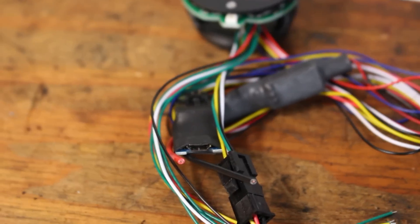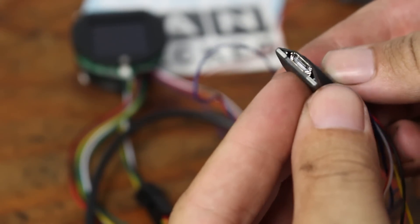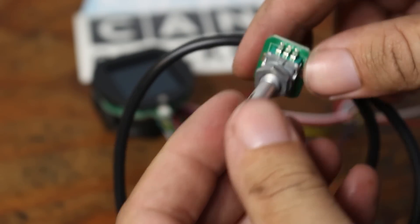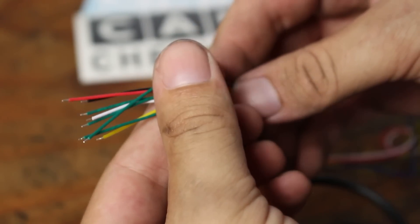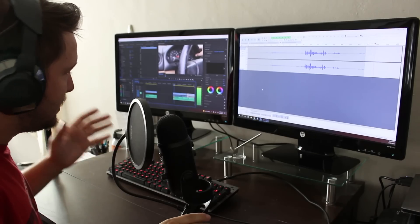This compact display replaces the oil pressure gauge in your Miata's cluster. Despite the wiring harness, this install is very easy. Being a German company, the instructions are in German, but an English version is available on their website. Wired to the gauge you have a micro USB port for firmware updates, a small rotary switch with a long harness to control the displays, and a small harness for power, ground, and the CAN connection to your standalone ECU.